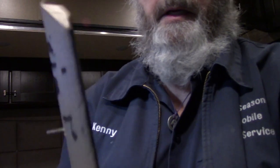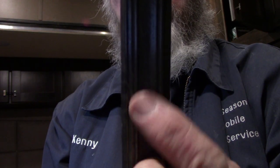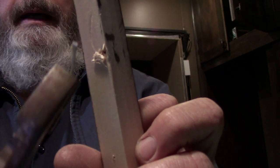See, I'll show you. There's that brad in a piece of trim. There's where they put it in from this side, and then they just put the correct color putty over that. Now, if you tried to beat that thing back through and pull it out that hole, you'd have a big old hole here. You might have some marks where you pried on it. We'll just do it from the back side. Just this easy. Look here. We got no hole. They didn't actually do a very good job filling our hole, but we did not disturb this side of this trim. We just pulled the brad right out the back.